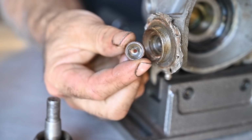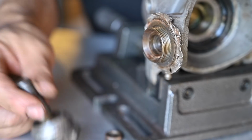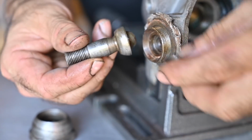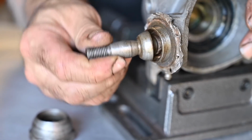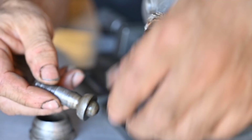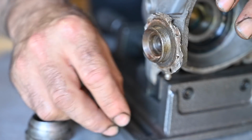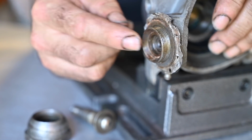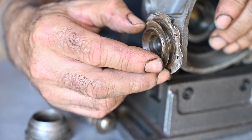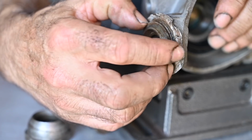Now inside you will find this little pivoting point that's sitting right there. And then you have the ball joint itself fitted like this. So that's how it can rotate inside. You're going to start having wear and tear on this surface, but also on the little point inside. Now on the top one there is no spring. In the bottom one there is an additional spring. And then you can start taking off all the old spacers. There's a whole bunch of them on here.